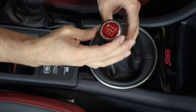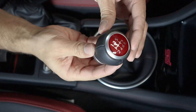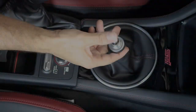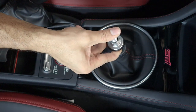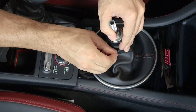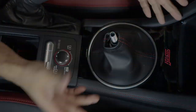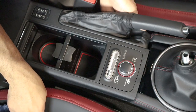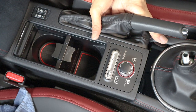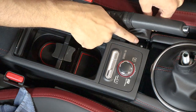The first thing we have to do is disconnect the gear shift knob — just turn it counterclockwise until it completely comes out. Right beneath it you'll find the reverse locking mechanism and the boot underneath it has to go over it, so just grab the edge of that boot and carefully work it around that reverse gear lock. Move back to the emergency brake and then grab the cover from under it and simply pull it upwards until you hear it snap. Move it out of the way and that'll reveal one of the screws holding the center console in place.